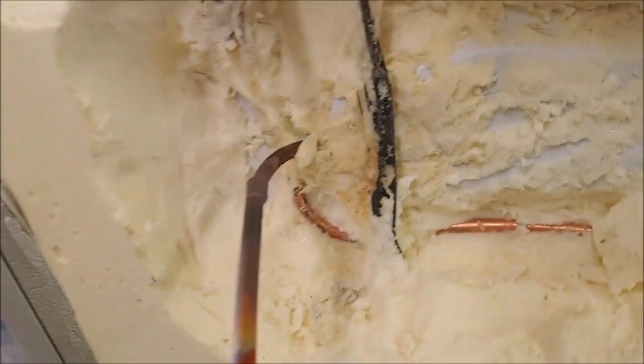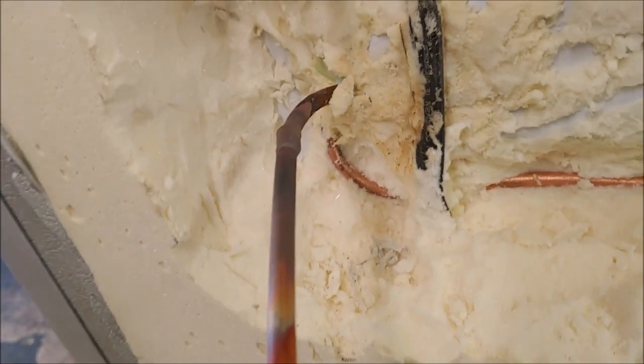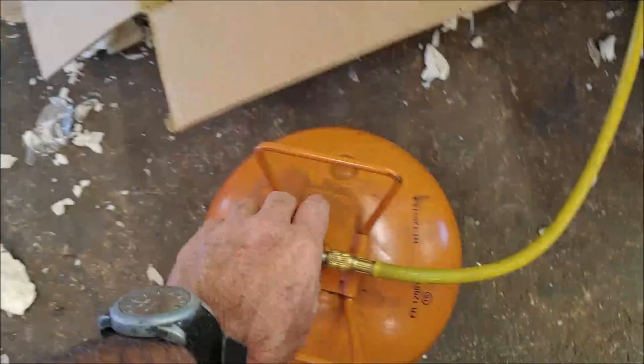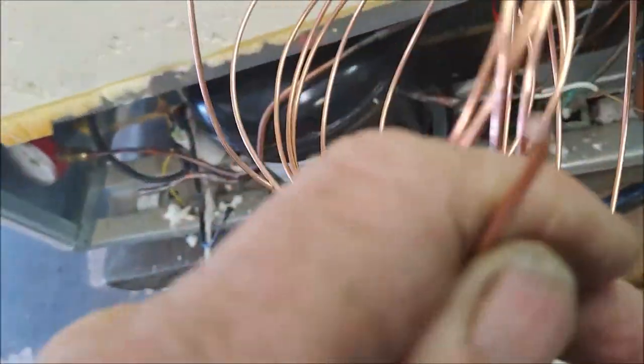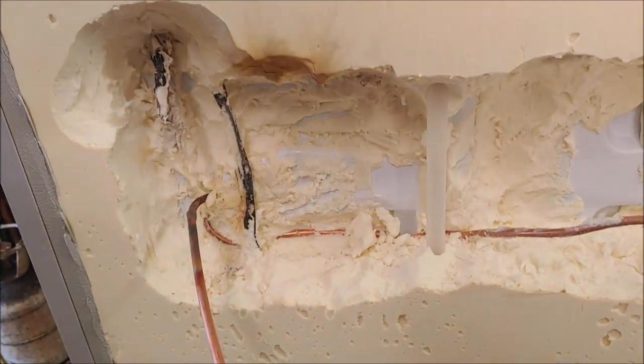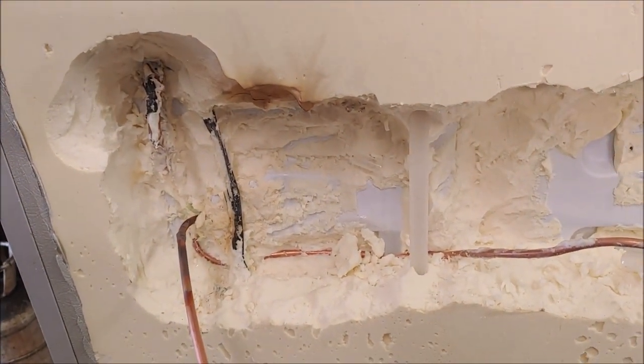On the other side, with the little quarter-inch part that comes out, I've welded a longer piece of quarter-inch on and connected it to a bottle so we can blow some pressure through and make sure it comes out the open end of the capillary. It's blowing through nicely so there are no blockages, and there are no leaks — so that's the freezer part done. Now I'll do the top bit for the cold plate.